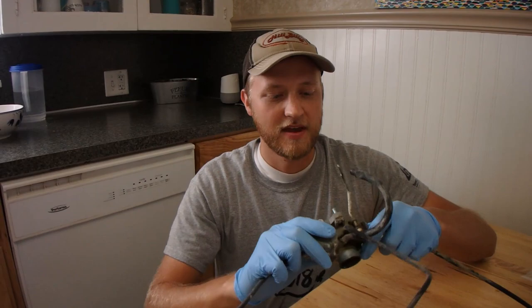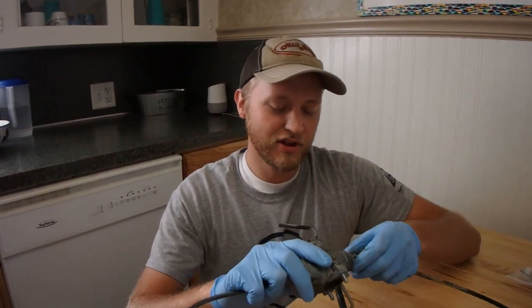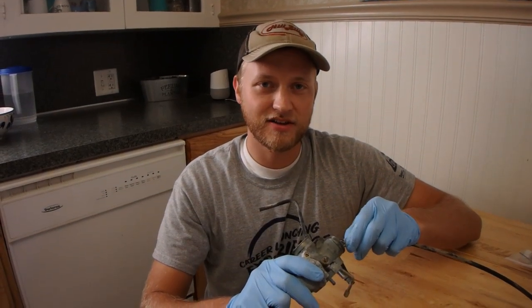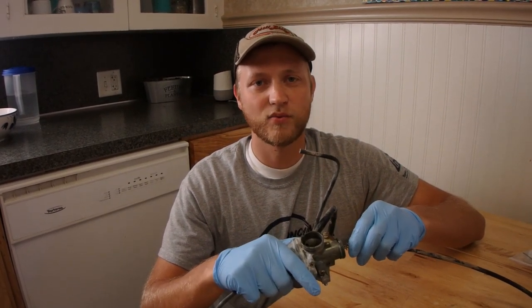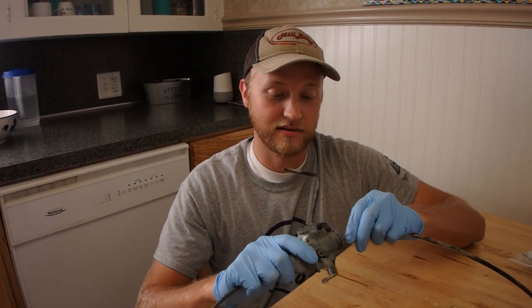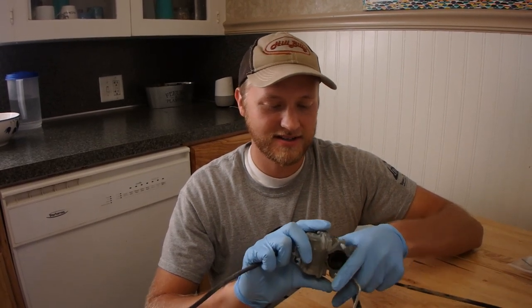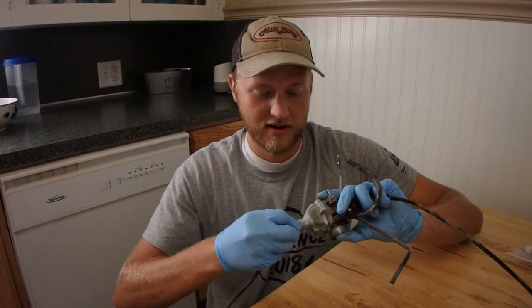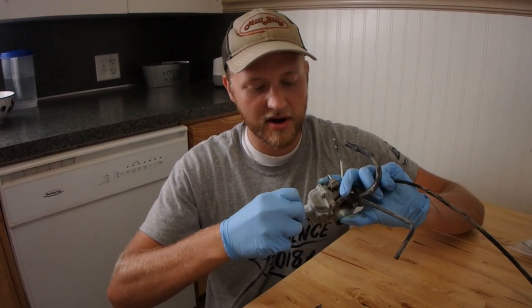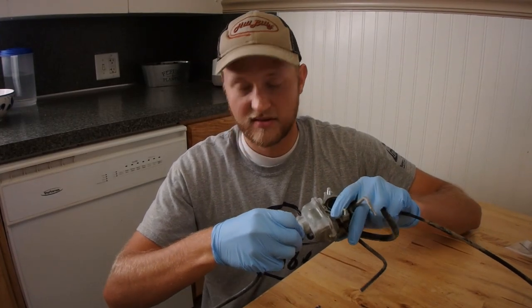I got a beautiful carb rebuild kit with all the knick-knacks and goodies — new parts, five bucks. I love the smell of new parts! I was looking up chemicals I could use to get this apart, and it turns out a lot of people are boiling these in water — it loosens things up. So we're going to try that today. First I'm going to disassemble it as much as I can, then pop it in a pot of water, boil it for maybe 10 or 15 minutes, and see what happens.